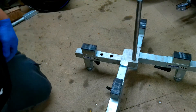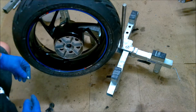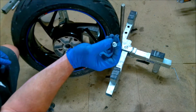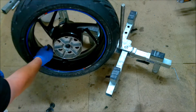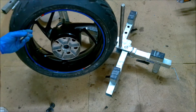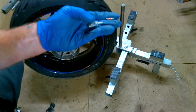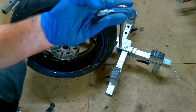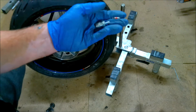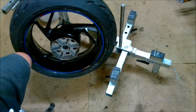Offer up your wheel. First thing, let all the air out - for which I use a valve tool. Take the valve right out and make sure when it's almost out that you hang on to it, or else you'll find the tool and the valve go flying across the workshop. Valve's out, no air in the tire. Now to break the bead.